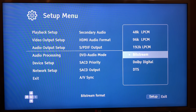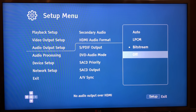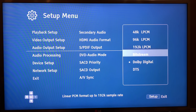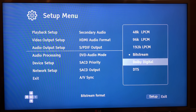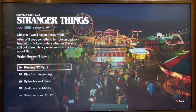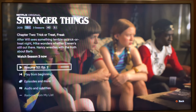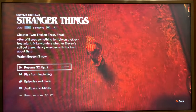Not supporting DTS is a big problem if you have a lot of Blu-ray discs. My Oppo UDP-203 does not have a system for converting all audio into Dolby Digital through HDMI, but there is a workaround: it has an optical output and the subwoofer has an optical input. The Oppo UDP-203 has an option to convert all audio into Dolby Digital when using the optical output. To test performance, I watched Stranger Things on Netflix. The surround speakers are fairly underpowered compared to the soundbar and subwoofer — you'll need to keep them very close to you, or increase their level which introduces distortion, or decrease the overall volume.